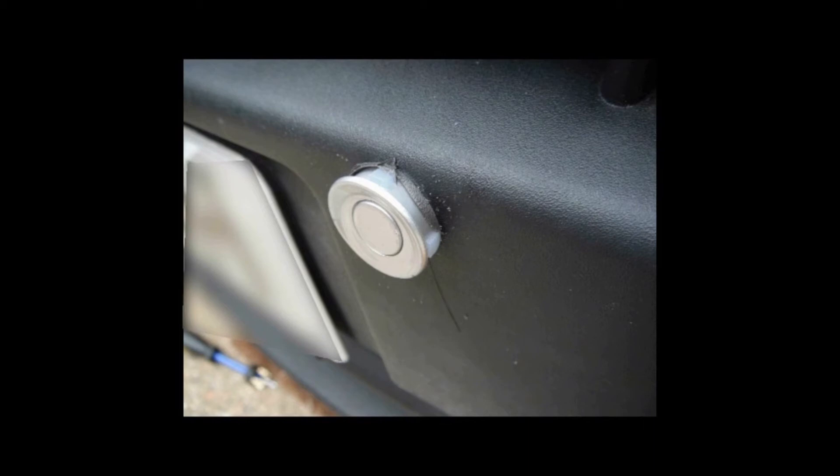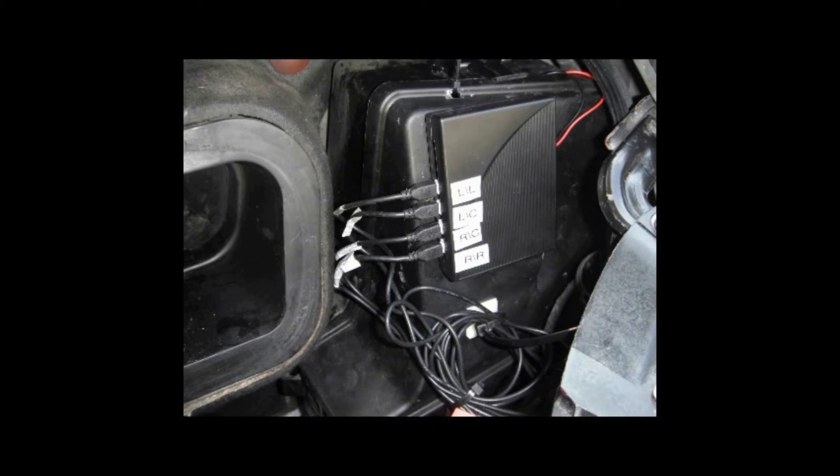That's the result — that's as far as I could get the sensor in, which is a bit of a shame. I didn't expect that and I should have looked out for it, but I wanted to show you that because I did promise warts and all on this video diary. So I painted it up with black enamel paint and put some black silicone round. There's the transmitter — I've attached it to the fuse box. The red wire on the top right is the single wire that goes into the cab to get power.